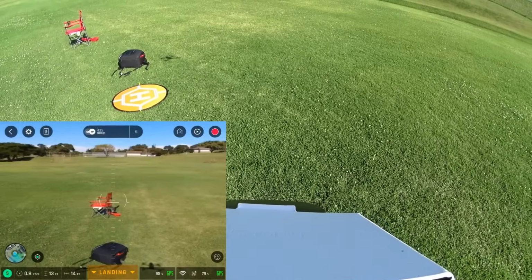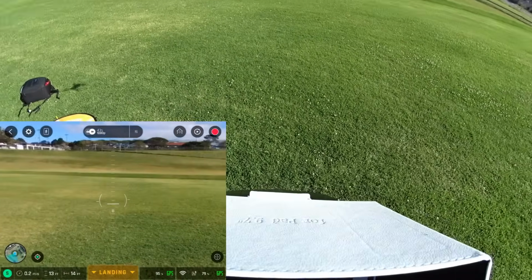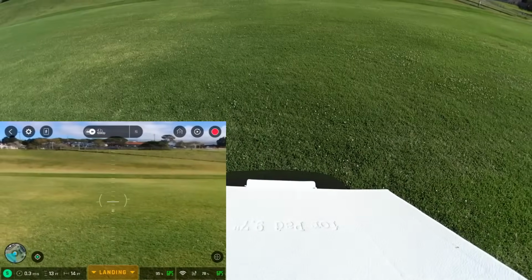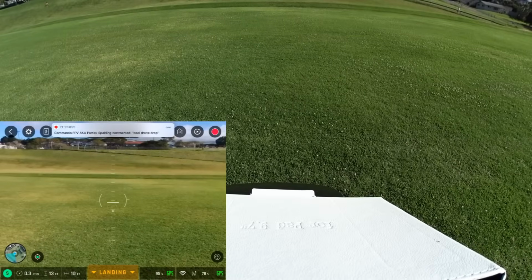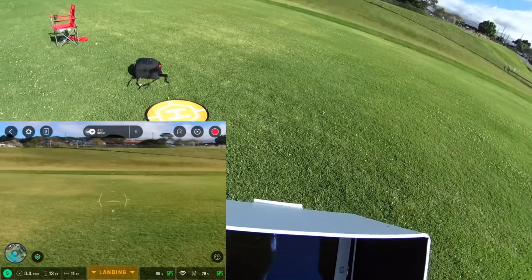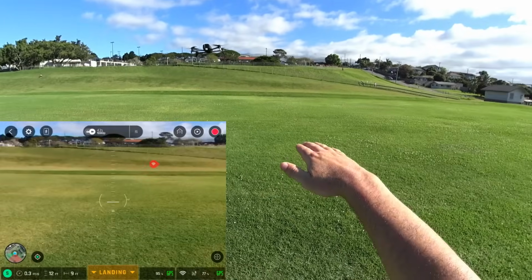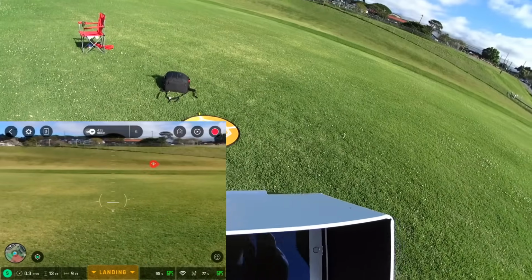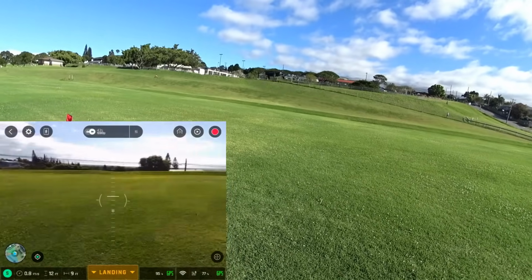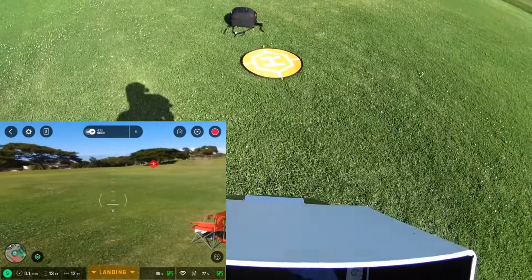And let's see how even the horizon is. So you see that line? That line on the park should be perfectly level. So it looks pretty good. Not bad at all for the horizon level. What I should have done is in the house, I did not calibrate for level on this. I should have put it on my concrete floor, perfectly level floor, and I should have gone into that drone level calibration first, but I didn't do that.